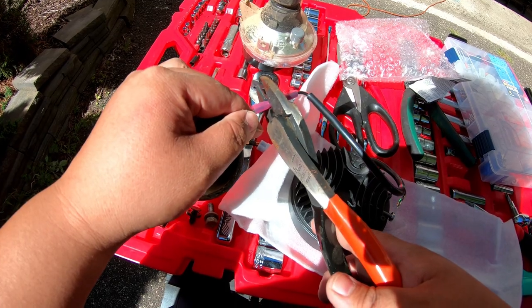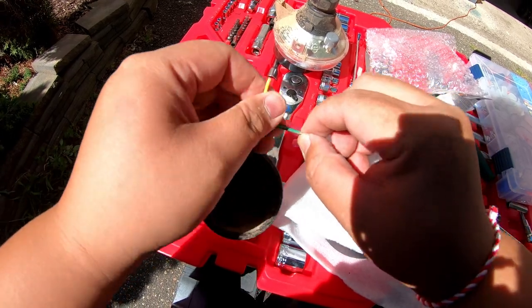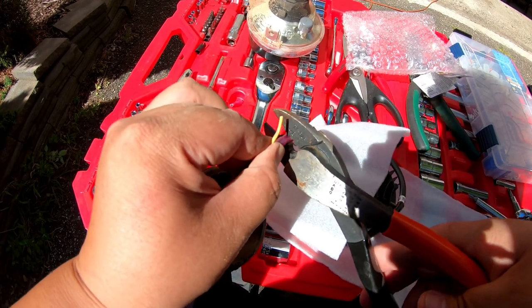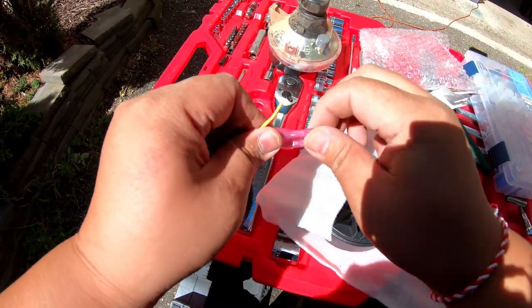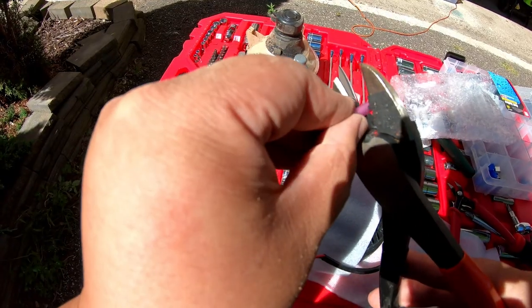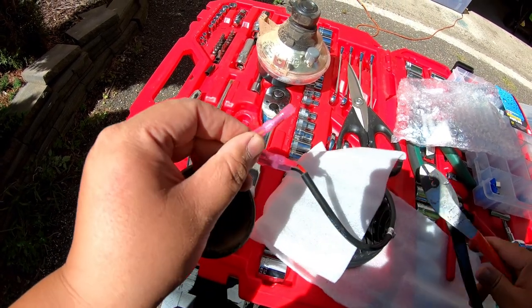It's going to go black to black — crimp it. Make sure you do a test pull, make sure it doesn't come out. And now you've got your green wire, it's going to go to the red. You might have to twist it. Make sure it's in there really good and all you got to do is just crimp it. Do your pull test. I'm just going to protect this one too — strip it. I do have some of these extras. You're no longer going to need this, but it would be good to protect it anyways. Crimp it. Test pull.